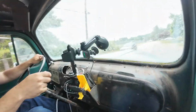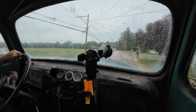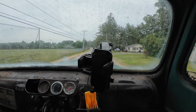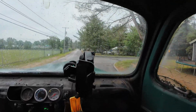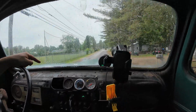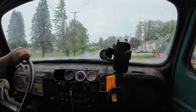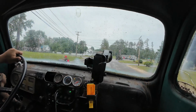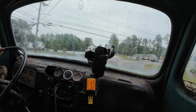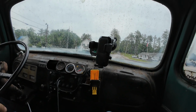Sounds like you're going 1,000 RPM. That's not even all the way up to the governor. No, I believe you. This driveline originally would have had a 2-speed rear axle. So it's got a single speed now, so the gaps between the gears are way too big. Next winter, I got a buddy who I sold the original engine out of this to, and he's got a couple auxiliary transmissions. So I think I'm gonna twin stick it next winter, so it'll have a 3 or a 4-speed aux box to split the gears. Because right now, if you get on a hill with a load, you get stuck at the top of one gear. By the time you get into the next gear, you're at like 20 horsepower levels of RPM. This thing is shockingly loud.